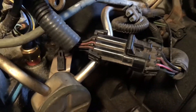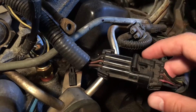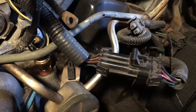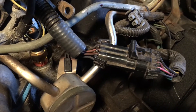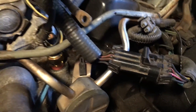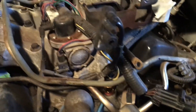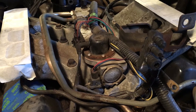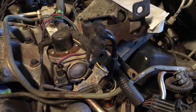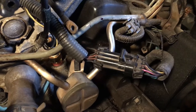You also have black and yellow for the temperature sensor. You can unplug this plug and measure your resistance between one of the pink wires and then one of the blue or green. From pink to one of the blue or green should be open, and from the other one you should get resistance. Check that, and then check from the other pink wire to the opposite blue or green. You should be seeing somewhere between 4 and 4.3 ohms in that area. Each of your injectors should be around 12 ohms, but here you're measuring across three of them in parallel, so that basically turns into 12 divided by 3, which is right around 4.